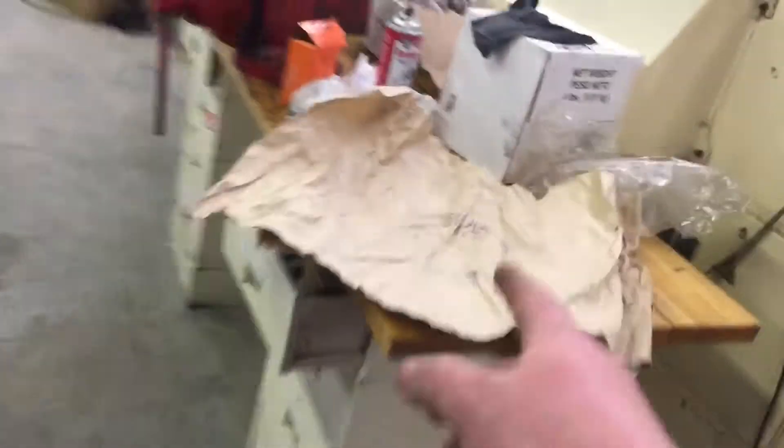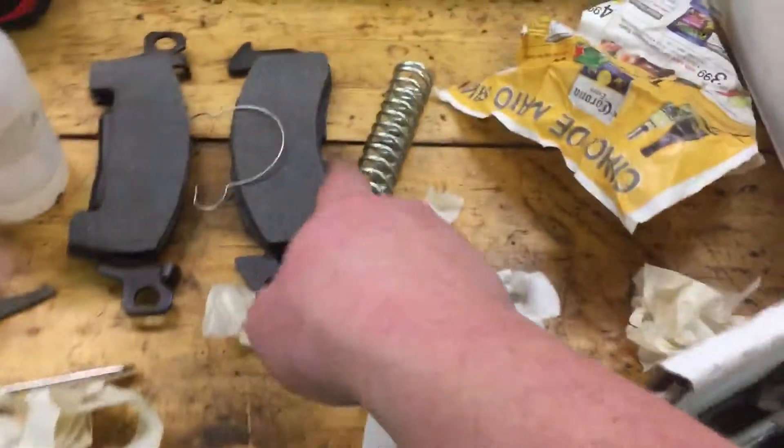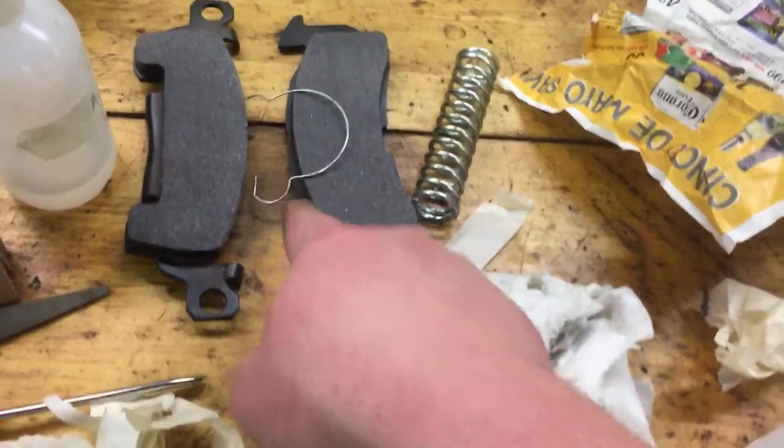I also painted my caliper. Coming back over to the truck — here's one caliper painted. I took the spring off, and taping that was a pain in the ass. This is where I cleaned my rotor, right on this piece of paper — brake clean, I love brake clean. I took the spring off, took the pads off, and that thing off.